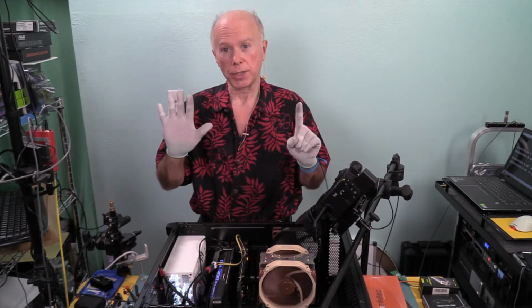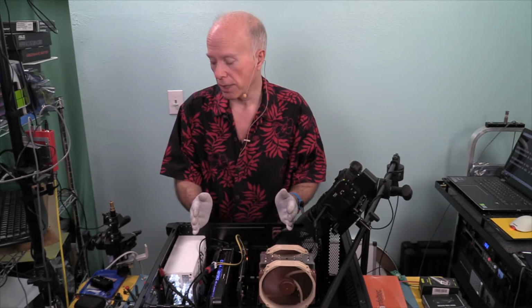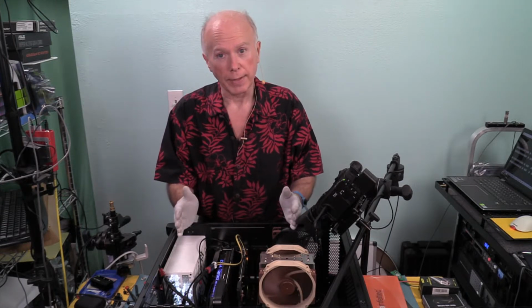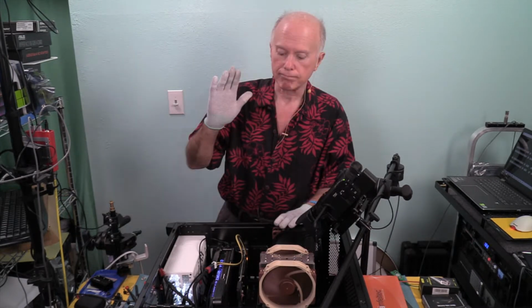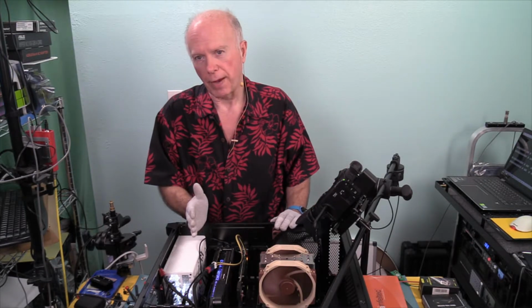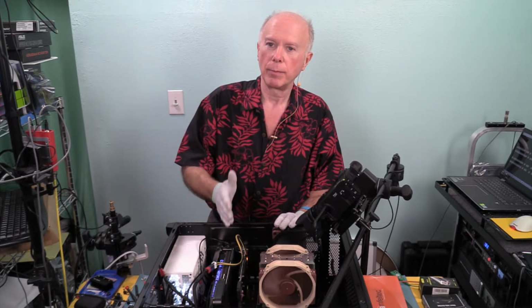Even though I have all 6 drives in the first RAID, my suggestion would be to put only 4 drives in it, and then take the other 2 drives and put them in a separate RAID. But again, we're writing to 6 drives. You see the numbers we get. I could do what I've just said, but it's about a 45-minute to 1 hour deal, because I have to destroy the RAID, rebuild it, and put Windows back on it.